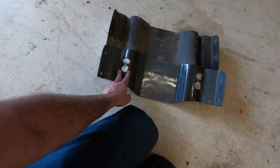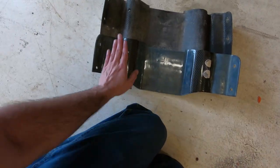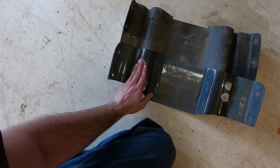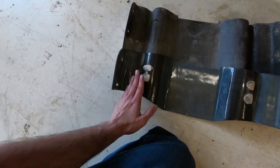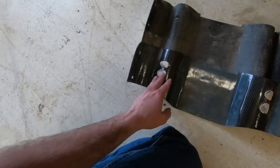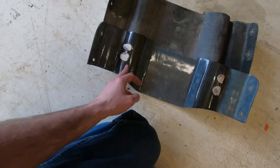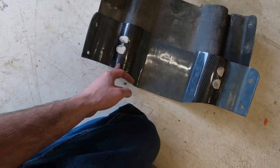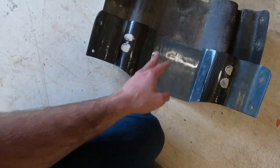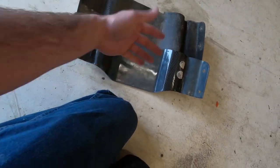Realistically, if you run a strip of pookie this way and this way on both sides, then put your wrap on your ski upside down and smash it, it would conform perfectly to your ski and you have more contact points. Because what happens is you don't have a contact point — it's sitting there going up and down on the water as you're going across it. Then it gets a little fracture or a crack. You land a backflip one day and it goes whoosh, straight across it. And all of a sudden your ski's pulling to the left or the right because this thing's hanging off of it.